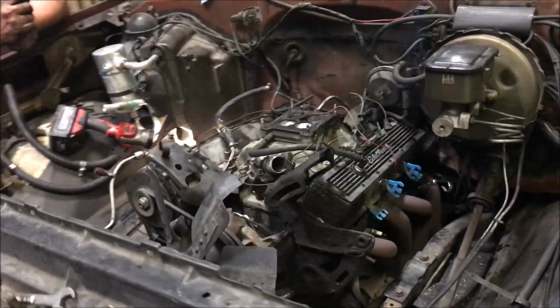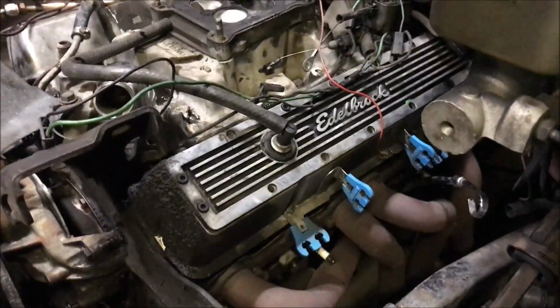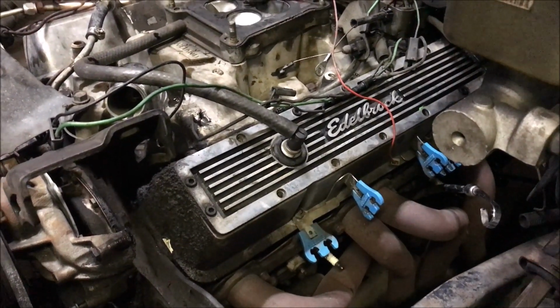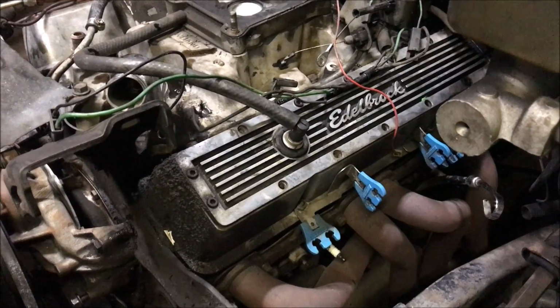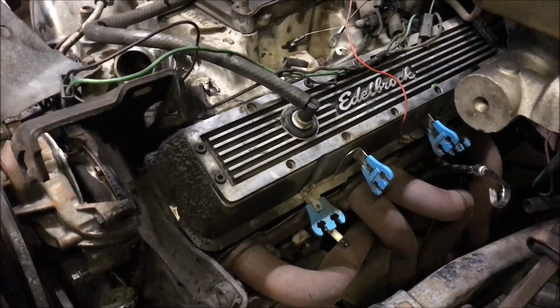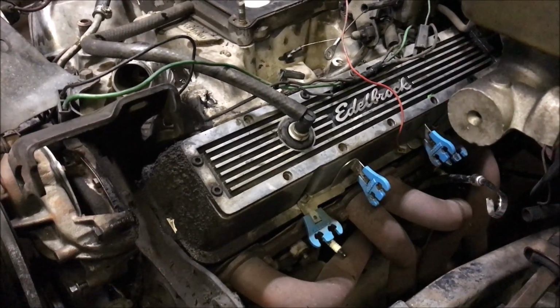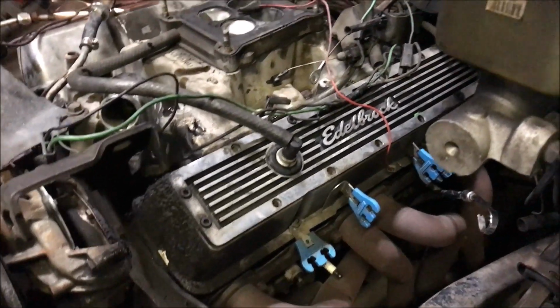What we can find. I think it's gonna be a bent push rod over on this side of the engine. I think it's gonna be burnt valves. Perhaps a burnt valve, or bent valves, one or the other. Something's going on over here, I think. Donnie's saying since there is a crossover pipe on the exhaust, it could be either side and you wouldn't know.